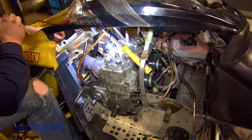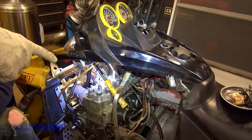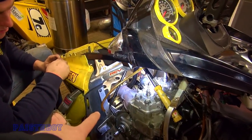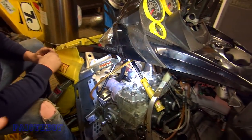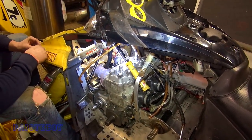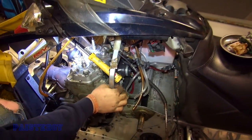The weather sucks — it's sleeting and everything's freezing. We had to stop a little early yesterday. We've kind of got the motor in place — it's fully mounted. Are you using a rope to hold your pants up? You put all the bolts in, right? There's four bolts in and they're all torqued down. We replaced a bunch of the fuel lines and the oil line. We did have to remove the Y-pipe and the one rave over here because we just couldn't get the motor back in with the starter on it. We figured it was easier to take the Y-pipe back off than the starter.